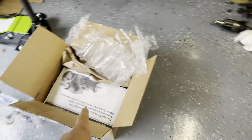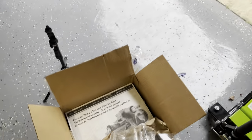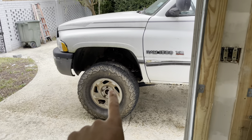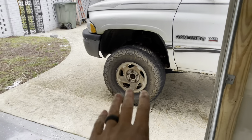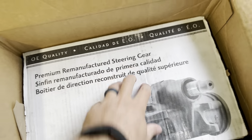We have a few hours today to work on it before it starts raining. If we don't get it done today, I'll probably be able to do it this weekend because the exhaust is happening on Monday. We have this remanufactured steering box. I was going to put a high dollar Redhead in it, but it's got no sway bar — I removed the sway bar — and it's lifted three inches. It's never going to steer great, so let's just put in a remanufactured cheapy in there.